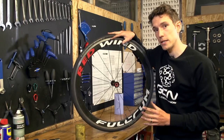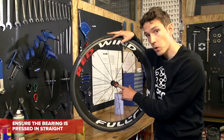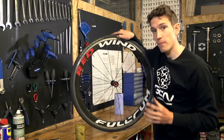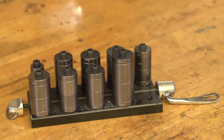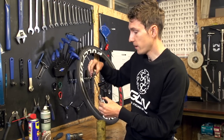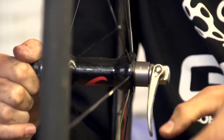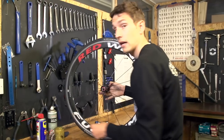Be equally careful when it comes to replacing your new bearings. There's a real danger that they can either go in wonky, or that you can damage the bearing itself by putting too much pressure on the inner race when tapping it in. So at the very least use a drift, but for best results use a bearing press. Our little homemade bearing press supports the bearings and then threads on to a quick release skewer. Replace your axles wherever you took them apart — just remember how you did it.